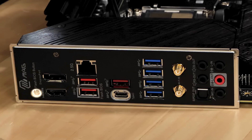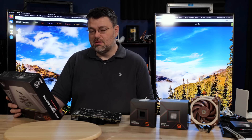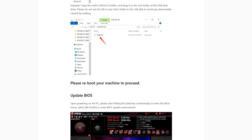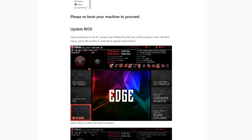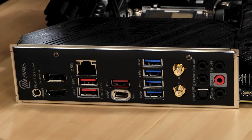At the rear I/O, there's a BIOS flash button that lets you flash a BIOS from a USB stick — important because new CPUs could come out and not be supported. If your system is dead and won't boot after waiting the DDR5 training time of a couple minutes, you may just need to update your BIOS. You make a special flash drive, put it in a special USB port, hit the button, and even without a working CPU the platform flashes the BIOS so you can boot your new CPU. There's DisplayPort and HDMI out, 2.5 gigabit LAN based on the Realtek 8125BG chipset, two USB 3.2 Gen 2 Type-A 10-gigabit ports, plus a Type-A and Type-C at 20 gigabit.